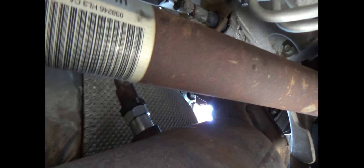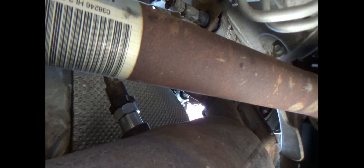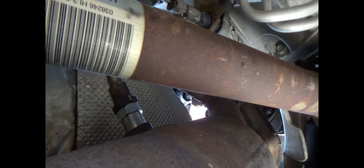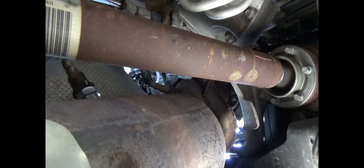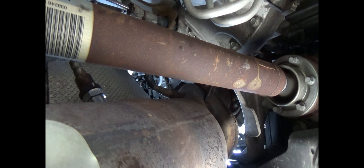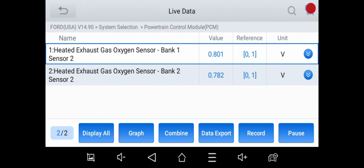The spacer's in — it's just pulled that O2 sensor up. It's still going to be able to detect exhaust, it's just not going to be as sensitive. I'm going to put this shroud up and clear the codes and go from there.